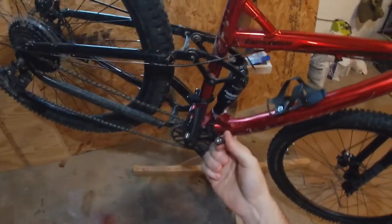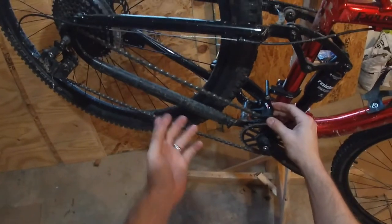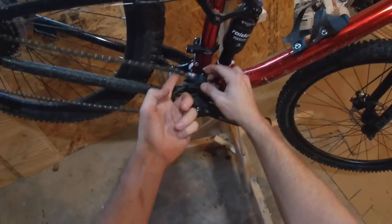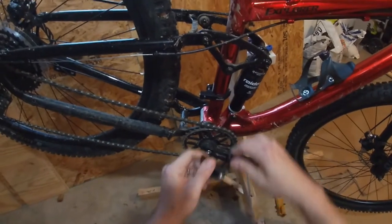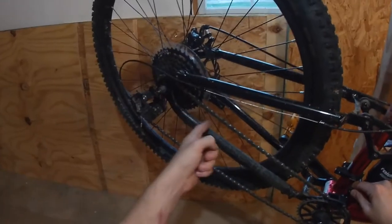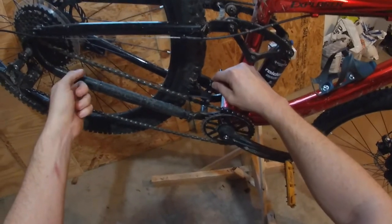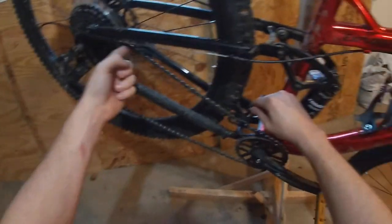Next, I need the guide itself. What this does is it sits right over the chain, and any kind of bumps or shocks that lift the chain off the chain ring — this sits on top of the chain and stops it from lifting off. The closer I can get this to the chain ring, the better. When I change gears, in the lowest gear the chain is very low, but in the higher gear the chain is going to be much higher up. So if the guide is further back, it's going to hit the guide when the chain moves up and down to go from a higher gear to a lower gear.